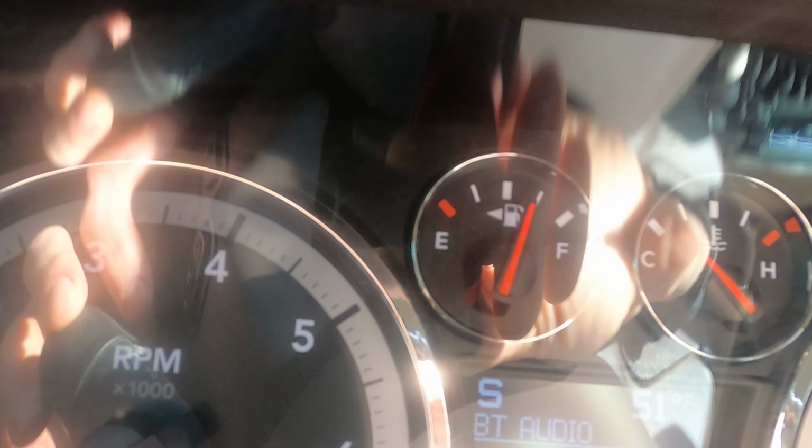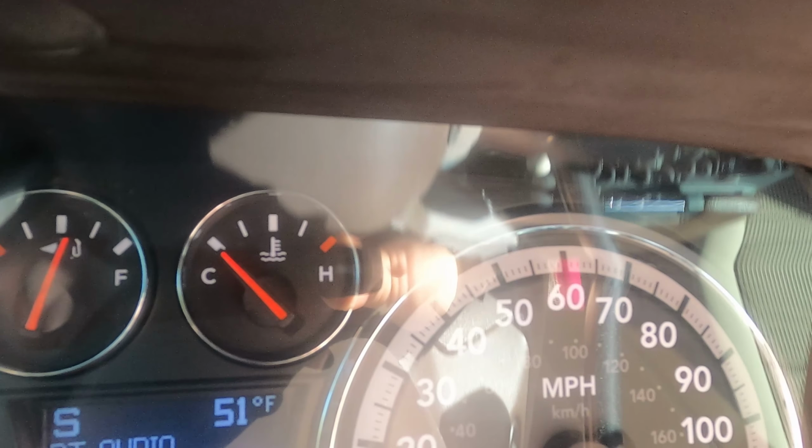Turn signals sometimes flash erratically because the circuit is different than normal now with the bulb out. It's really easy to do. You can just go to your auto parts store and they have a little book that'll tell you the size bulb you need. You can Google it and it'll be there as well. For trucks, it's really easy to change the rear lights. It's really easy to get at the rear light housings.